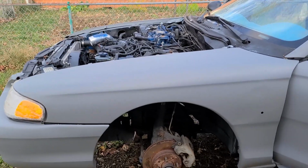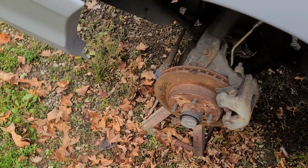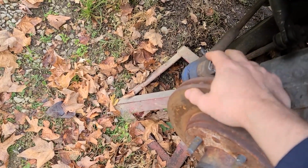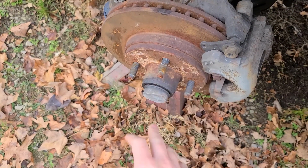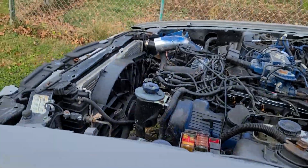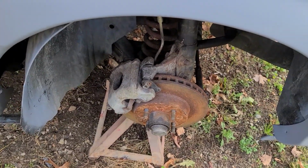And then next steps immediately, I'm just buttoning up the front suspension. When I got this, it was all kinds of wonky, and I've pretty much sorted it all out. It's not a big deal to finish it. The cotters on the tie rods, I've replaced those. As well, I've made sure everything's tight. I've taken apart the front hub bearings and cleaned them and repacked them. You know, obviously the brakes are working. I've replaced the ball joint on this side. It was really bad, and O'Reilly's, shout out to you guys, gave me the wrong ball joint on this side, so I will have to replace that.